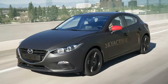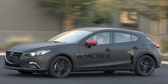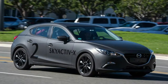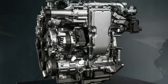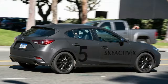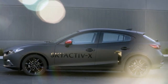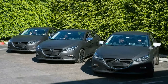That takes a few essential components to get just right. One is a massive amount of computer processing power and pressure sensors in the individual cylinders, because ambient conditions change how and when these things happen. Skyactiv-X uses a clutched supercharger to pump in additional air when needed to nail the mixture precisely, and high-pressure injectors to get the low ratios of fuel to disperse properly in the chamber. Since it operates like a conventional gasoline engine sometimes, it uses valve timing to lower the very high compression ratio so it doesn't reach compression ignition in that mode.